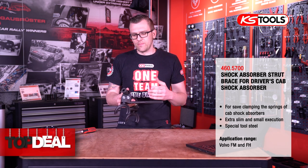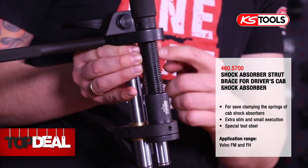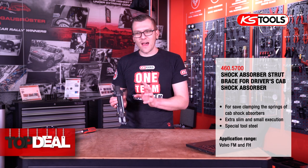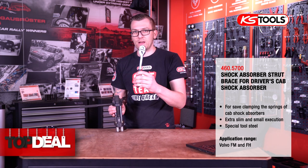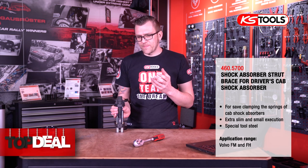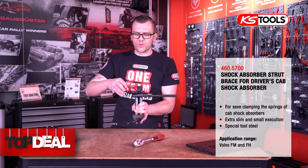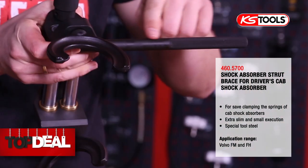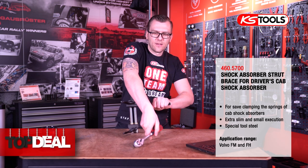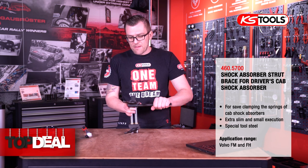Let me talk about the details on this tool. Starting from the back, you have a spindle with a trapez thread, but please do not use it with an impact gun. For the long life of the spindle, use a half-inch ratchet — something everyone has in the workshop. While compressing the spring with the ratchet, the tool wants to move a little, so we have this arm on the side that you can grab and hold tight while operating the ratchet. It works absolutely perfectly.